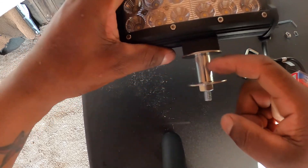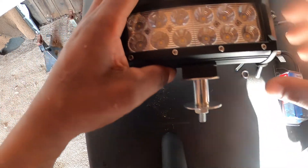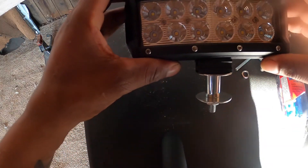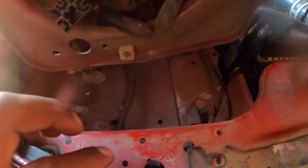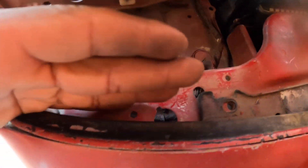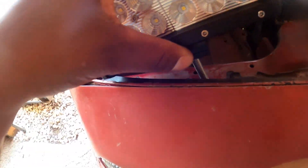I'm going to grab one of these spacers right here. I've seen people stack tons of washers, but I don't recommend that. What you could do is use this big washer so it can be more sturdy — put that, and that, and that's it. Then the actual nut goes on the bottom. Let me just show you how it's going to look. That way you don't add a bunch of washers. So let's just go to the car and see if I have to drill anything.